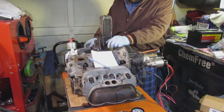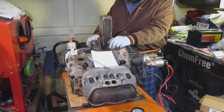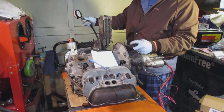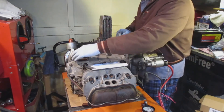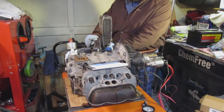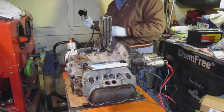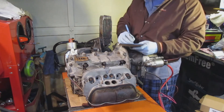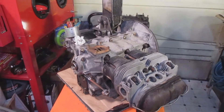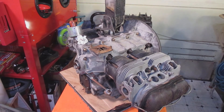That's what I do for all four cylinders — the same process. Checking the compression, you want to make sure it's about five percent from each other when you calculate everything; you don't want it to be too far off. If there is one cylinder that doesn't have anything, check the valves first before ripping everything apart — there was about one time that I did have a bad head. So that's day seven. I hope your build is going well and these videos are helping you out. Thanks for watching — don't forget to like, subscribe, and share this video with those in the Volkswagen community or who like to work on cars. Have a great day!